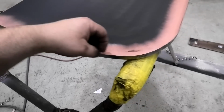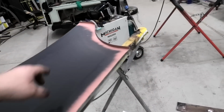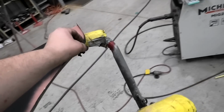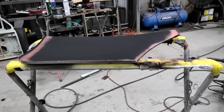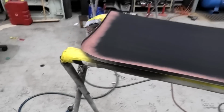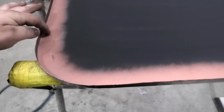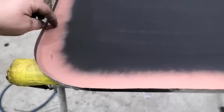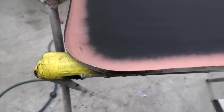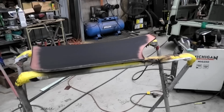So all I did was shrink through here and a little bit there, and I had to heat up this end a little bit too because it's very tight to go around there, but realistically it can be done. And I suppose the same sort of method can be done if you were just doing a small repair, say on an EJ or EH where they rust the bottom of the doors off. You could do a little half moon and basically copy the same exact style. But I'll sit that in there and see how we're looking.